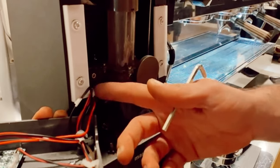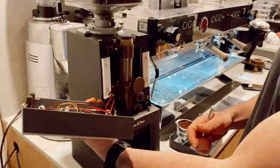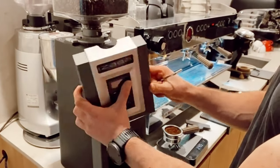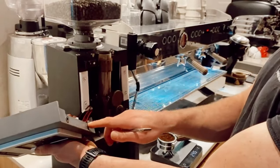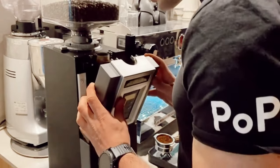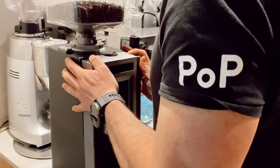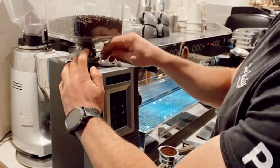Also be aware that the cords and wires are still connected, so be sure to hold on to it quite firmly. When putting it back, same way you took it off — line up the spikes with the two holes underneath the main component, push down, sink it just under the screws, and then finger-tighten to make sure it doesn't come off during operation.